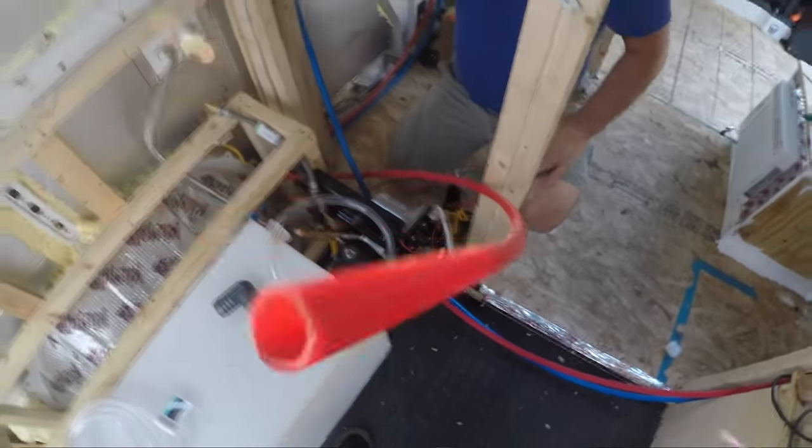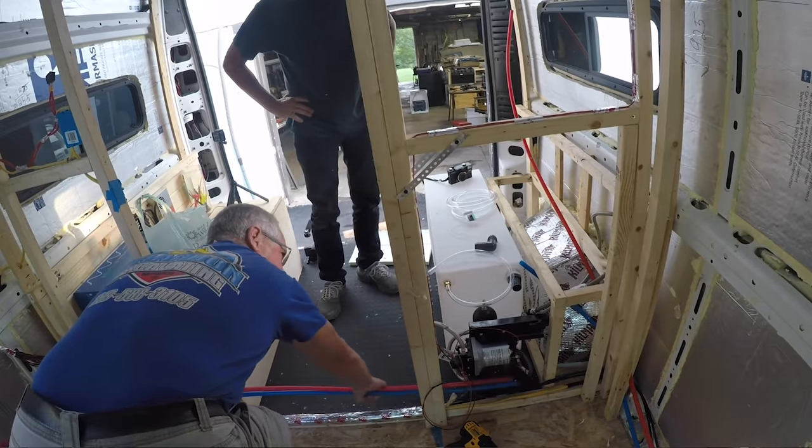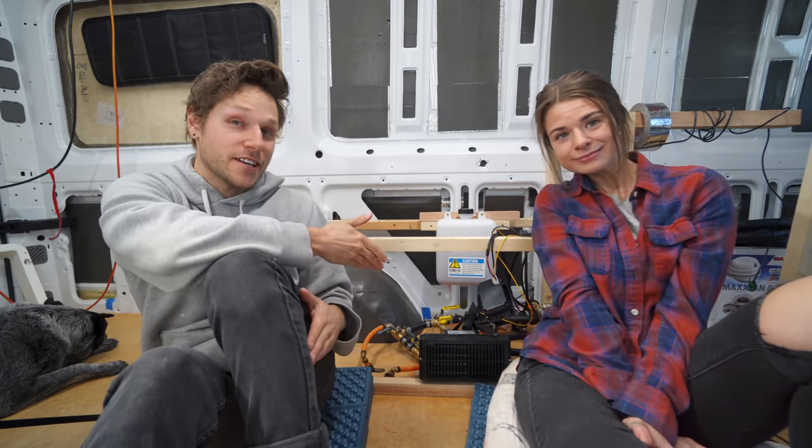And don't get me wrong, this takes a lot of pre-planning on your layout. In my previous van, I had the plumbing running from one side of the van to the other because I had my shower over here and my sink over here. And when it got cold out, it opened my lines to be able to freeze. This time, I made sure to keep all of the plumbing in an accessible location, under this bench seat right here, along with the hydronic system, so that I can have shorter lines,